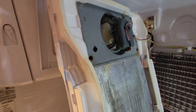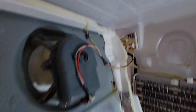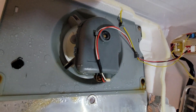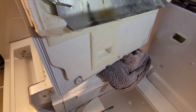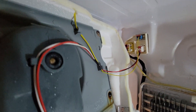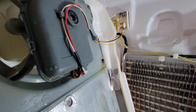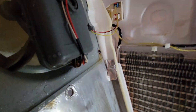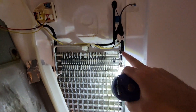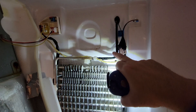Okay guys, here's what the back of it looks like. You can see all the moisture. There are your plugs that you have to unplug. Luckily for mine, they gave me enough wire so I got it on a towel down here and I can get to the plugs. You've got two plugs you need to unplug and get that out of there. Here's the problem, guys — I will show you. Now mine doesn't have a lot of ice buildup, but maybe some of it defrosted. There are a lot of guys that have ice buildup around here. And then they've moved their thermal sensor from here over to here.